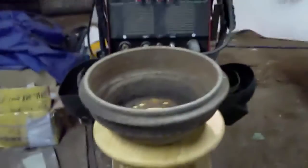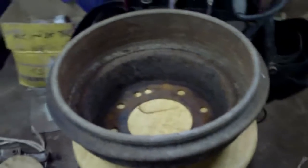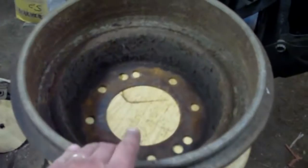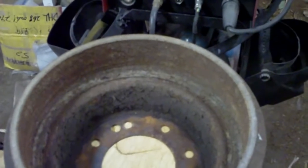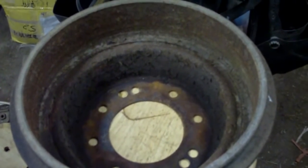I'll go over and have a quick look at that — not that you're going to see anything — but the drum here doesn't look like what NAPA has listed for it. As a matter of fact, the dimensions aren't even right. The NAPA book and some other resources say that the inner diameter of the drum is supposed to be about 11 and 5/32 inches when new, and this one is more than 12 — it's actually close to 12 and an eighth.